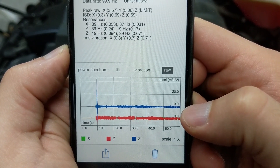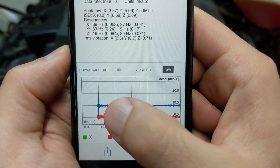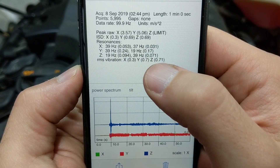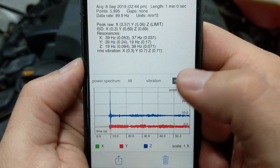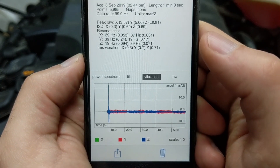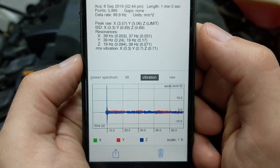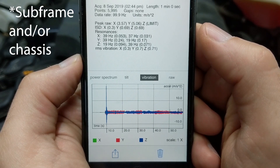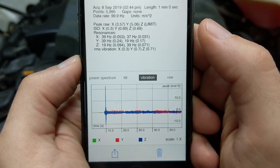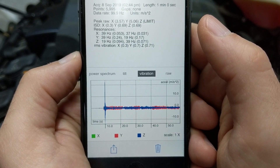The baseline was eight; this is looking like maybe slightly more, maybe nine. We see the big spike again, but look how tight the pattern is. Most notably, look at the upper limit Z: 0.71. So unless I'm interpreting this incorrectly, it looks as though the vibration has actually decreased. My running hypothesis is that since the mounts are solid, they might be taking all of that vibration and drawing it into the mounts themselves and out through the drivetrain — whereas before, the OEM mounts, especially because they were leaking and loose, may have been transferring much more vibration into the engine itself.